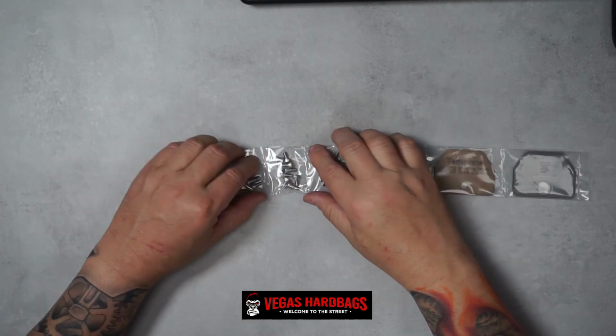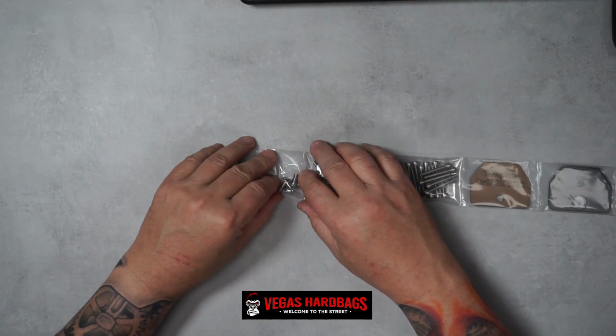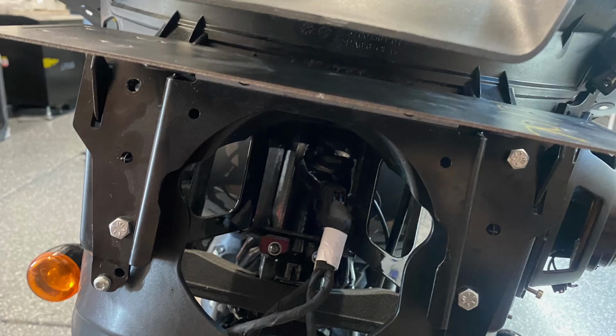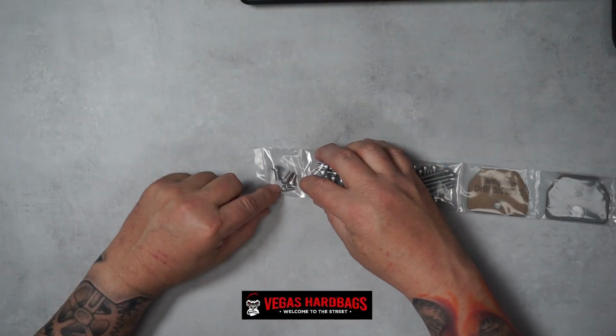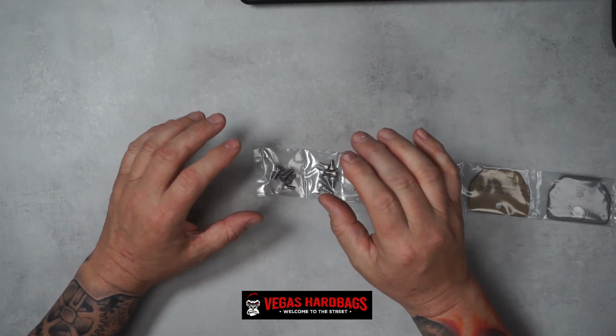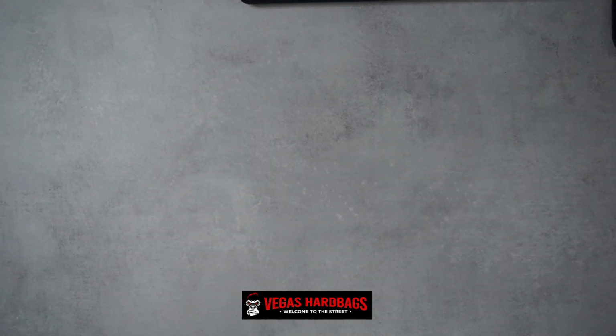These little guys, these little M4s right here, these are going to the horn drivers. And then last but not least, we have the 1/4 bolts right there for the factory, or excuse me, the amp rack that's going to go to the factory fairing stay, and then the 2 amplifier bolts, because we don't need 4 to mount the amplifier down to the rack, only 2, and it's threaded. So that's our hardware kit.